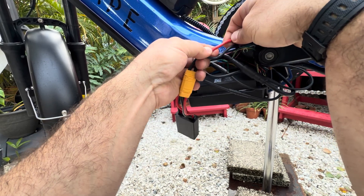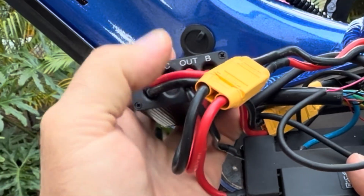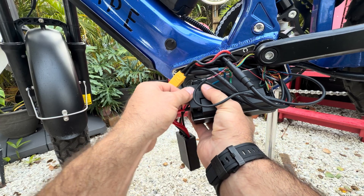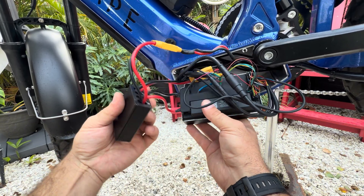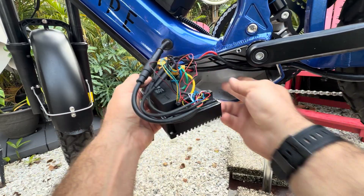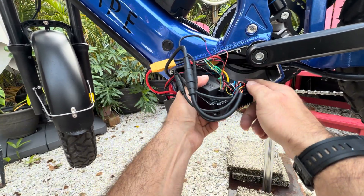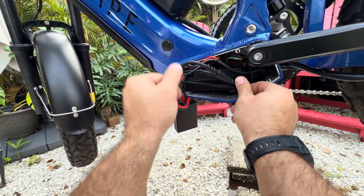It's XT60s for your connectors here — that's pretty common and definitely something I want to see. Coming off of the balancer you can see it right there — it says 'out,' and that out goes to the controller. Those two controller pins are screw-mounted to the Bafang controller, so it's a little different than plugging straight into an adapter. If I was doing a mod and had no other recourse, I'd probably just cut these ends off and put XT90s on the other end.